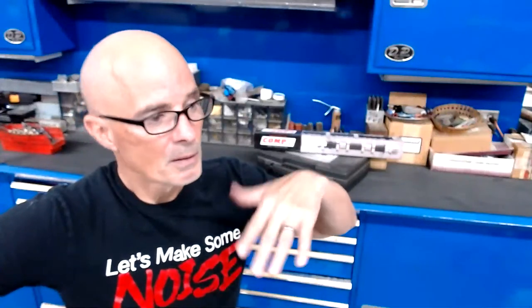Yeah, if you're running very high ambient temperatures, E85 is good. And we see a little bit of gain on some of the NA motors with the E85. Sometimes we see some gains down low, but usually not near the peak. The exception to that has been the Coyote and also the Gen 5 LT motors. Charles, I think I'm going to order a 2.5 pulley for it.